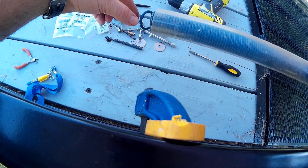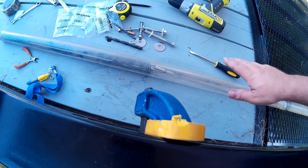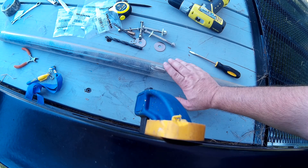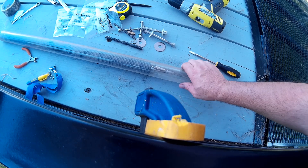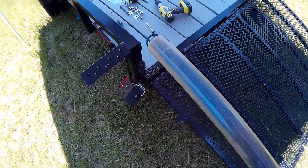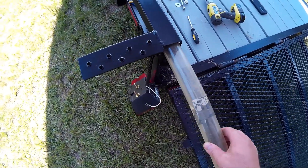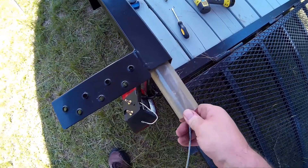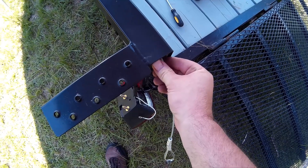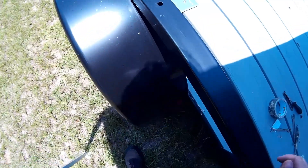The cable and the spring are inside the tubing — the spring is going to stick out just a little bit. I drilled my hole at 65 inches so my polycarbonate tube is about 63 inches long. That will allow enough room inside the frame rail for this to slide back and forth without any binding — it can move freely as the tailgate goes up and down. Now as a single unit we're going to slide this up inside the rail — this is inch-and-a-half polycarbonate tube. I'm going to push that on up in there a couple inches and hopefully the spring is right at the hole we drilled.